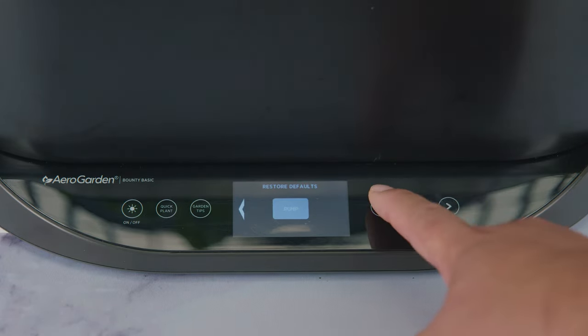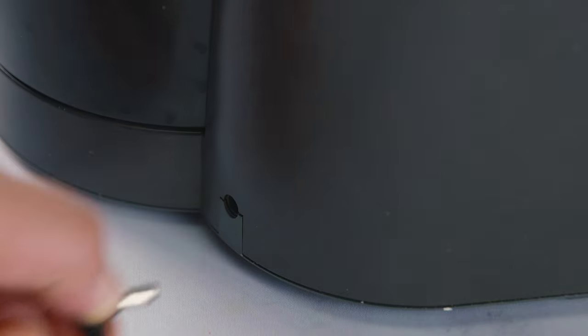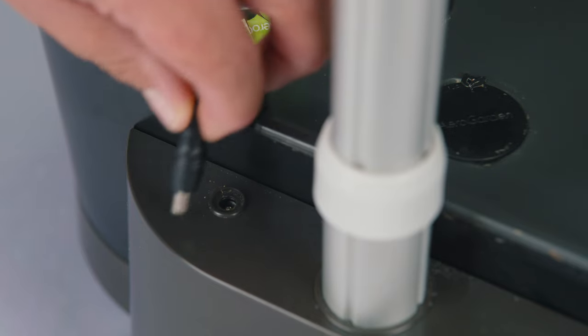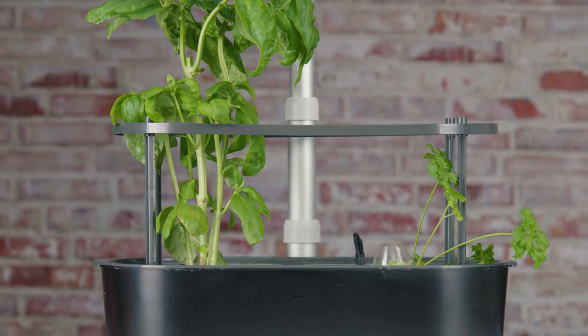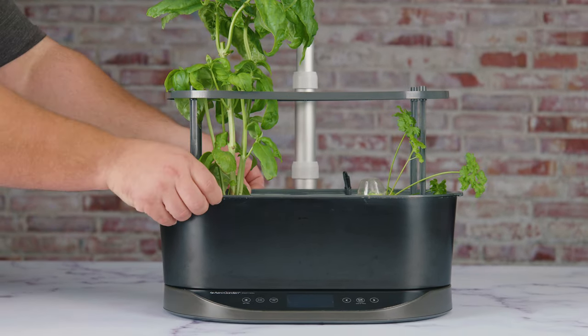This is basically going to work for most brand systems. The first thing we're going to do is disconnect it from the wall, then disconnect the power to the system. If at the top you have a secondary connection, go ahead and disconnect that one too, because even though this is low voltage, the last thing you want on a clear sunny day is to get hurt.